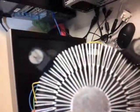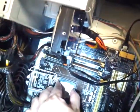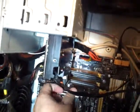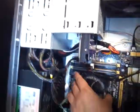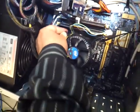Now we are going to put that processor back and bring the workstation back up. You want to make sure you apply some thermal compound between the processor and the heat sink — what it does is when the processor is running and gets overheated, this compound helps keep the processor cooled down. Before you put it back, make sure you orient it correctly — those small brackets are supposed to line up. Lift the lever and seat it back in.